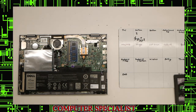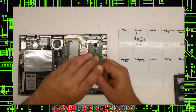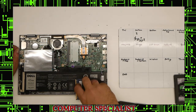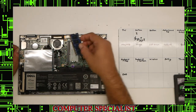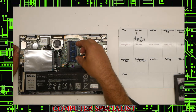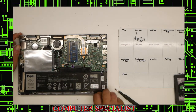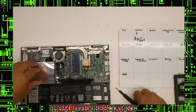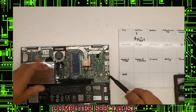So on this model you will see it's got four gigs of RAM. We're not going to touch the RAM, but if you want to upgrade to eight gigs, it's DDR3L 12800 — you can go with an eight gig stick. For this customer, we're just looking to speed up for basic use. So the first thing you'll notice is the hard drive over here is a spindle drive, and this is going to be coming out — this thing is running slow. We already diagnosed it prior to this video.